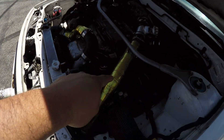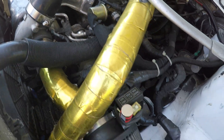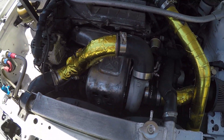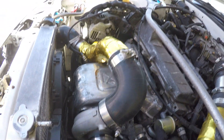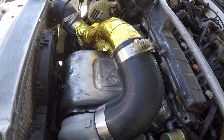This is a 3S-GTE, fourth generation model. You can also find this motor in a Mark II, MR2 — yes, those are the older generation 3S-GTEs. He has a Greddy intercooler with this piping, which I'm assuming is custom — yes, I had some old pipes lying around from an older project so I just put it together. I put the gold heat wrap tape on it to keep it from heating up since it's really close to the header on the hot side.